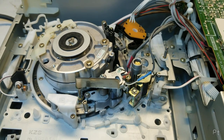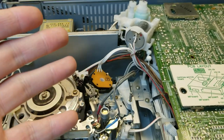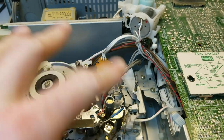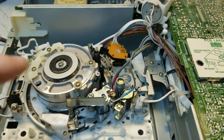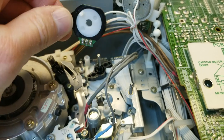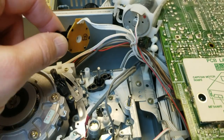This just gets weirder and weirder. So I decided to take the whole loading motor apart with the confidence from a 12 Volt Vids video on how to take these apart and service them. This is the 711 B3 chassis — the plungerless. So I popped out the mode encoder switch and gave it a clean, shooting contact cleaner between the PCB and the plastic. Then I went to go put it back in, and I'm watching his video.